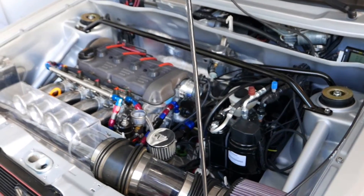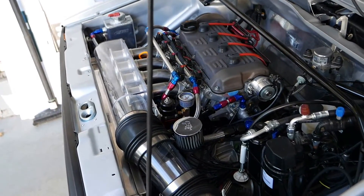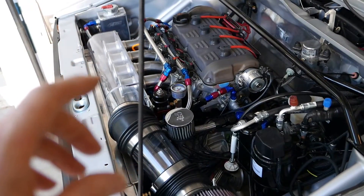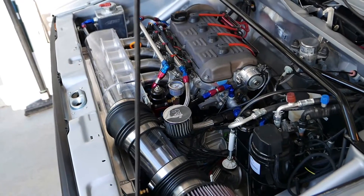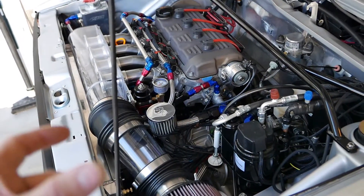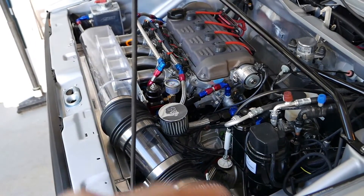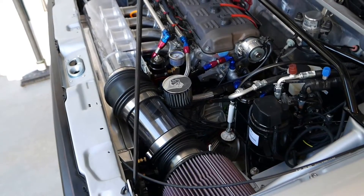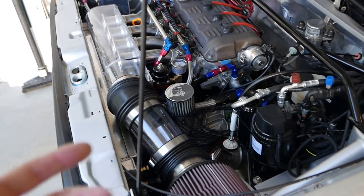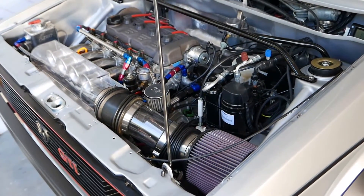I put a 10k resistor in series with the inductive crank sensor, and then I improved the shielding all the way to the sensor. I have a weather pack connector and I wasn't bridging across the connector with the shield, so now that's all bridged across. Even the connector itself has got metal aluminum wrap and tape around it. It seems to be working - I've just tested it and it revs up to 8,000 RPM.